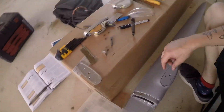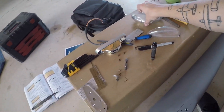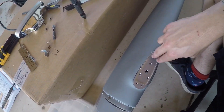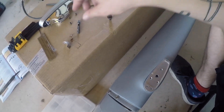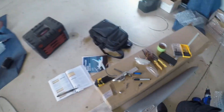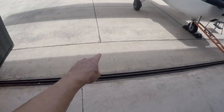In the meantime I'm going to go ahead and get these LED lights installed — I've got to drill a hole, line everything up, and bolt it in place. Here's what they look like assembled: you put this back plate on, it gets bolted on here, here, and here. Then this piece screws into the plate, and then the lens cover goes over the top like that. I'm going to put the plates on both wingtips for now, and then once the plates are on I'll go ahead and put the wingtips on the aircraft. I'm waiting strategically for the sun — the shade is right there and I'd like it to be a little further out so I'm not sweating when I put the wingtips on.